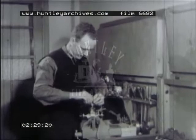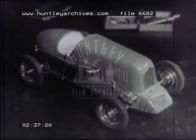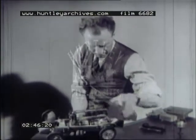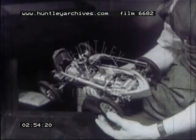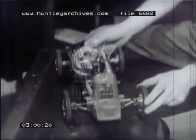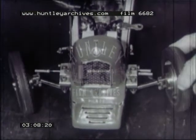During the war, other people took it up and built similar racing cars. Here's another one, a 3.2-litre Alfa Romeo. It was designed and built by Mr. Jones. Unlike most model cars, it has a rear wheel drive, so the steering has to be fitted to the front wheels. Mr. Jones has built Ackermann linkage exactly as in the full-sized car. This automatically gives each front wheel the correct turning radius.